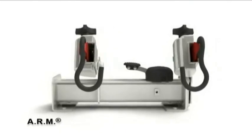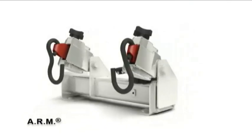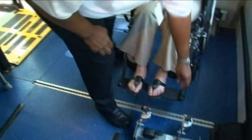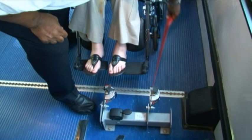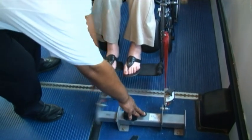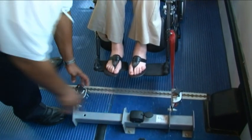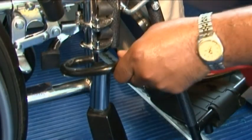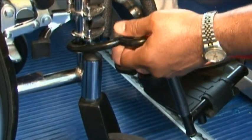Now, move to the front of the mobility aid. Here, use the telescoping ARM incorporating a patented and exclusive positive locking safety feature. First, attach the wall side belt. Press down the release mechanism and pull the ARM out until you hear and feel a secure click, ensuring it is locked into position. Now, you may pull out the aisle side belt and attach to a solid frame member of the mobility aid, as shown here.